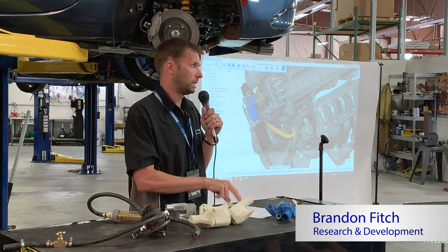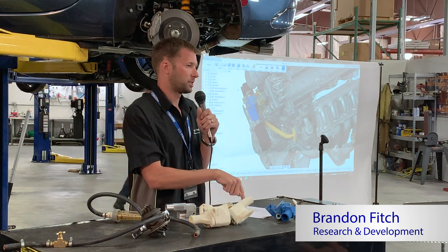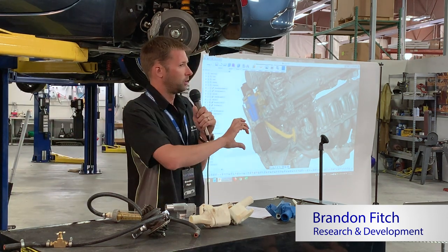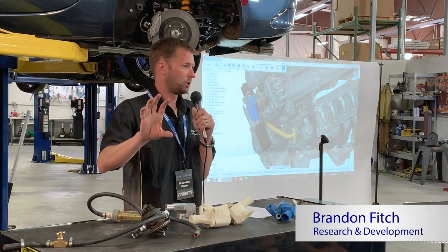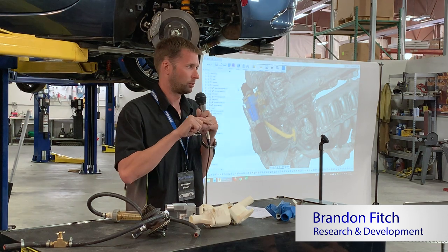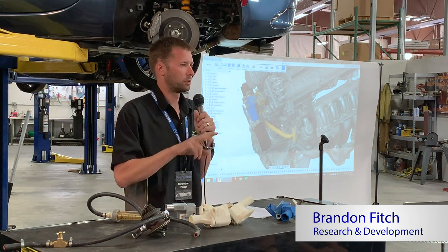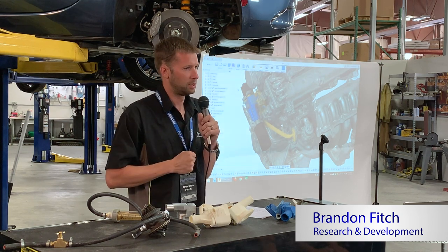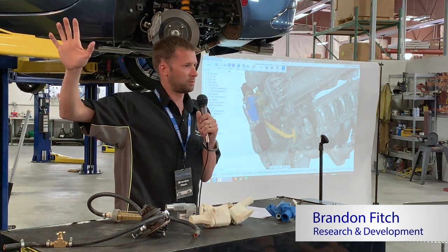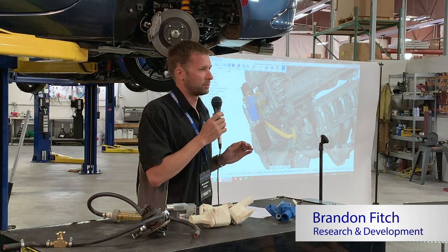So the turbo increases the coolant temperature by itself by as much as the engine does. Now, there is a qualifier on it. The mass of coolant going through the turbo is quite a bit smaller than the mass of coolant going through the engine, and the temperature increase is the same between those two different masses. So it's not super dramatic, but it's still bad. It's still a pretty significant increase.